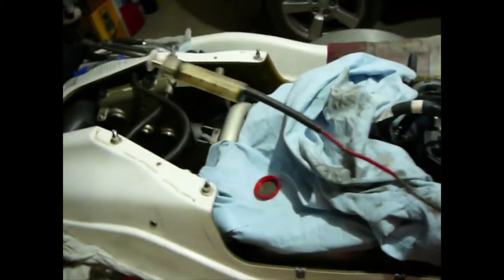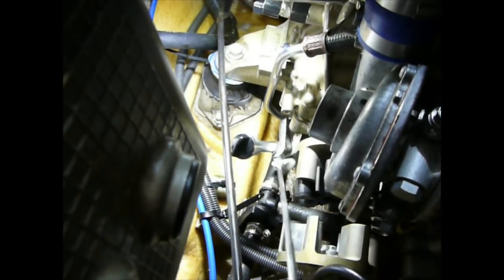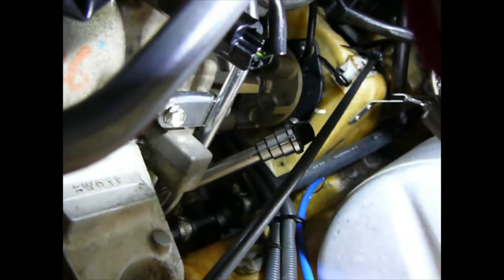You can see down at the back of the motor I've got a torch there now. Underneath the turbo, what I'm knocking against is the black cap on that tube that goes down into the bottom of the motor, into the sump area — that's the one you need to unscrew and extract oil from. Here it is from underneath the airbox, underneath the fuel lines and near the intercooler, where I've got the camera aimed towards the back of the motor where the pump impeller setup is.